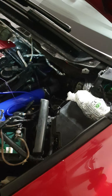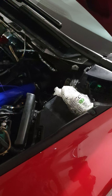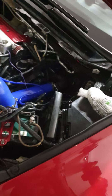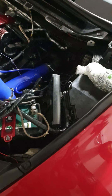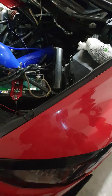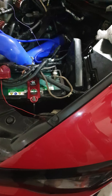That obviously goes into the car to the controller. So remember: from the turbo, on the same vacuum/boost line that goes to the wastegate, you tee into that line. That tee feeds off into the boost controller, and from the boost controller back to the wastegate. This application is for the external wastegate.